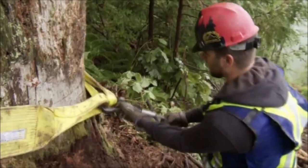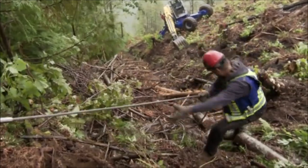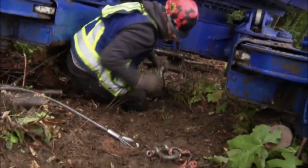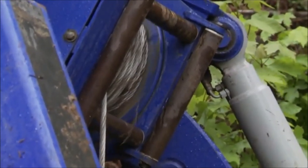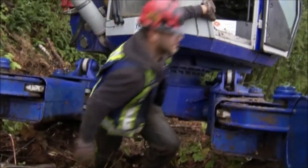On these vertical sections, the winch really becomes your lifeline that holds you to the hill. It holds the front of the machine down — it pulls it down and runs up behind you, so it's pulling your feet into the ground, giving you stability.